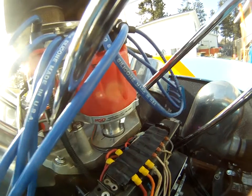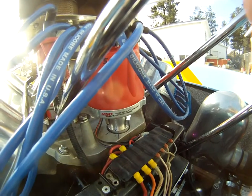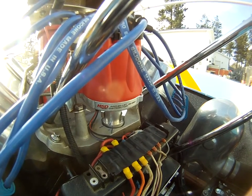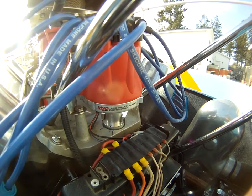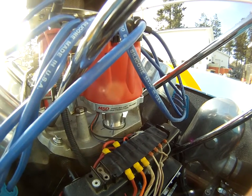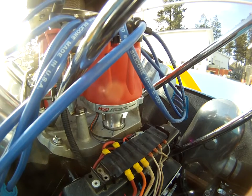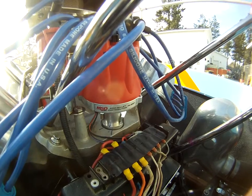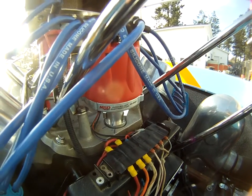When I did have these two lines lined up, which should be zero degrees, and I checked it with my timing light, I do believe that I was actually slightly retarded. I do believe that the pickup actually picks up the magnetic field slightly before it reaches the center point, and so it's actually slightly retarded at zero.